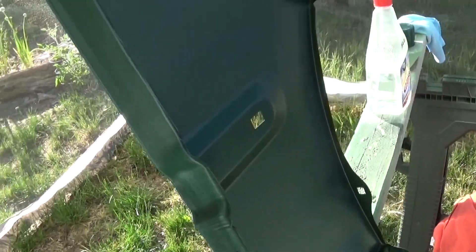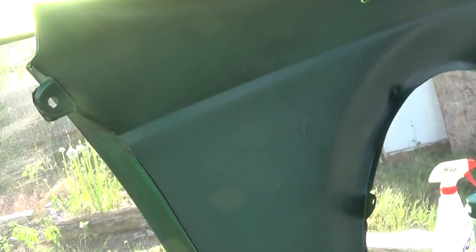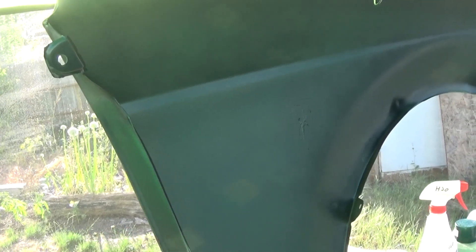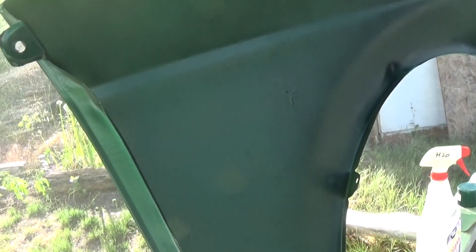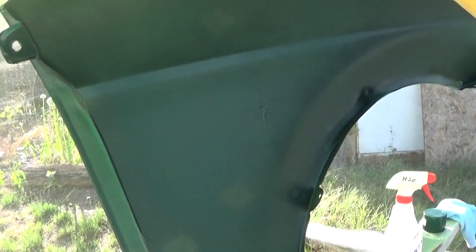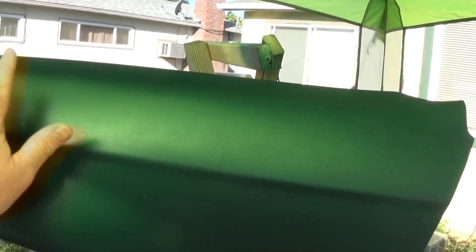Some things I've learned: when I do my next fender, I'm not going to waste any of the good paint on the back side. I'm going to use a primer meant for corrosion resistance, then put a sandable primer on top of that, and wet sand any defects out. On the back I don't worry too much — there's splatter and nobody's going to see that. Next time I'll just get some close green paint and shoot the back panel first, since nobody's gonna look at it.